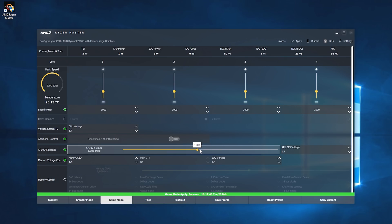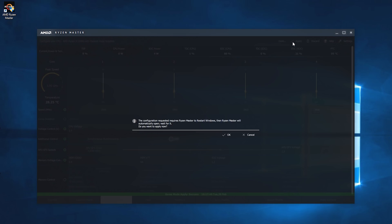The SOC voltage is particularly important as it is a single rail that feeds the Uncore and graphics domains. I found that 1.2 V was enough to stabilise the Vega 8 GPU at 1650 MHz, but I've also seen reports of users going as high as 1.25 V, which is the maximum voltage AMD recommends. For testing the GPU overclock, free tools such as the Superposition benchmark work well. You can increase the GPU frequency by 1 MHz at a time, but that would be painstakingly slow — you should be able to jump right up to 1300 MHz and then continue in small adjustments while also adjusting the voltage as you go.